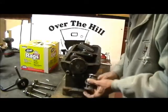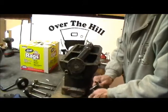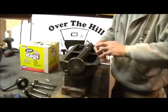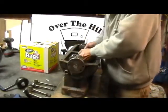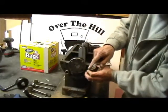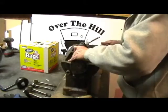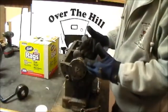The object is to get this cap to fit down on there and still be able to turn it — it's hitting on both sides. The main object is to hold this crank in place with these thrust surfaces; otherwise the crankshaft in the Model T can move back and forth, and after a while that will cause a lot of the mags to not work properly. So as long as we're rebuilding this, we want to hold this crank from moving forward and backwards. We can see the crankshaft thrust surface is cutting into the babbit, so we have to keep removing material until we can get this to slide down in there.